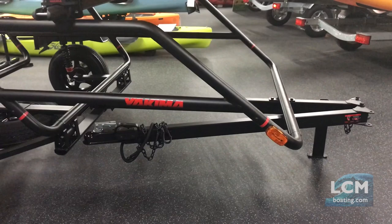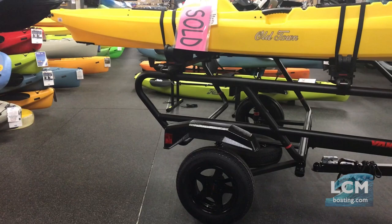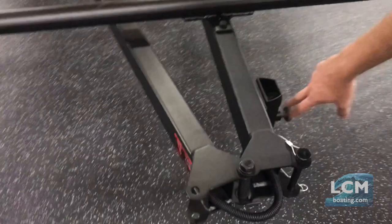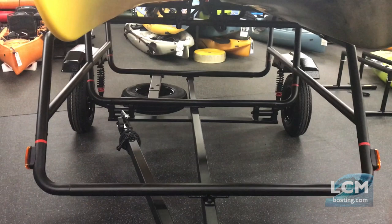Right here I have a 13 foot boat sticking out beyond the front, and you can see the overhang — I've got a solid three feet right out the back. So the trailer really compacts down nice and small for in the garage. It comes standard with a kickstand up front. This stand wheel has a pin and will pivot out of the way when you go to trailer — that's what your pull pin is right there. We use a two inch ball on this trailer and a flat four wiring plug.